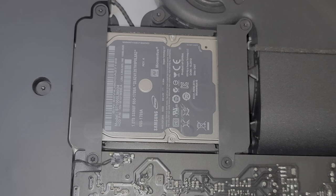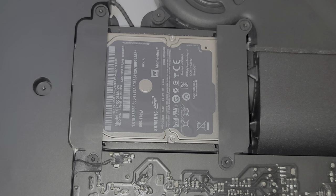I'm going to show how to replace the hard drive now. If you're going to do this, you either want to clone your hard drive or use Time Machine backup - that's probably the easiest way. Or you can pull your hard drive out and use an external adapter when you do a clean install. The clean install you can use the built-in recovery by holding Command Option R, and that does an internet-based recovery.